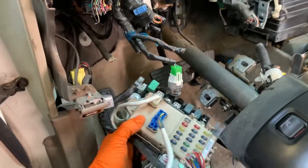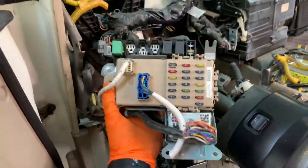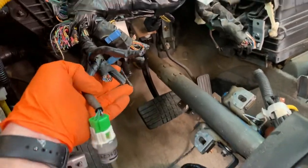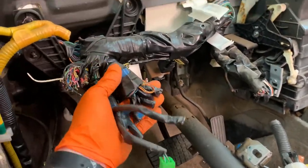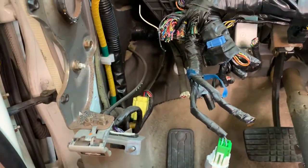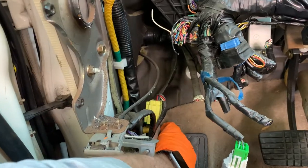So for the whole fuse box, I want you to see this. It seems like you would need some of this stuff, but you don't. So I cut that all off. It's gone. It's going in the back. Goodbye. We need this. So all these other guys, cut, cut, cut. We'll pare that stuff out of the harness later, and we're good to go there. And now we're going to grab this OBD2 port right here by prying this off and getting access to those wires down there.